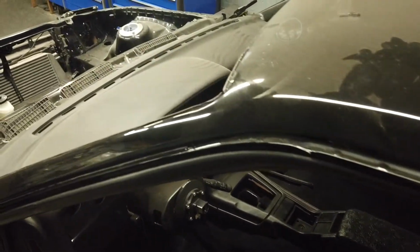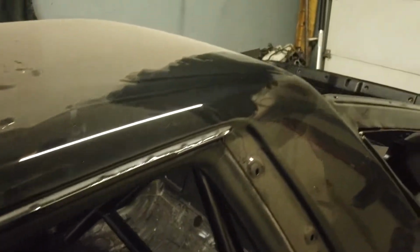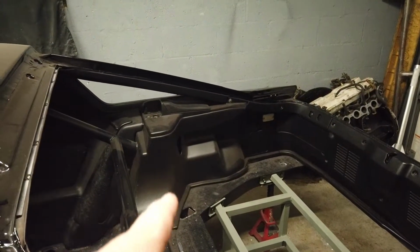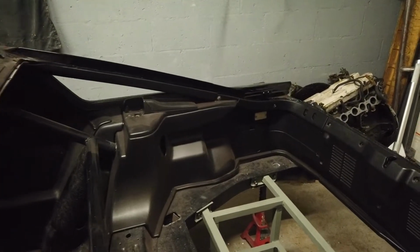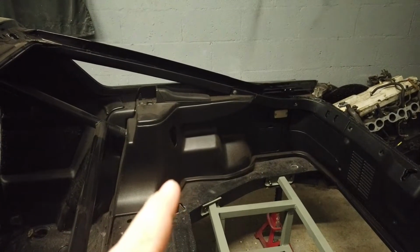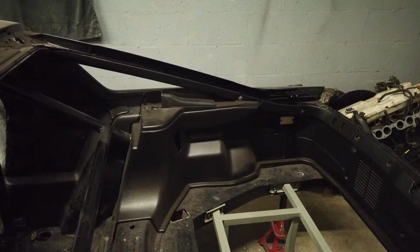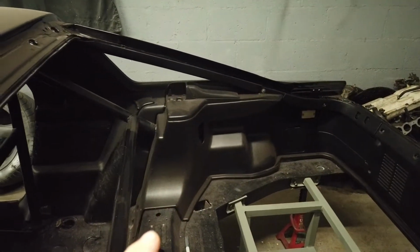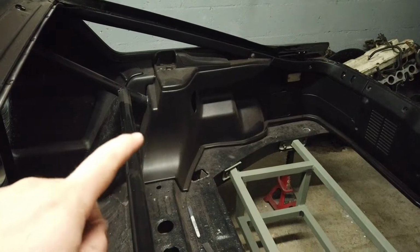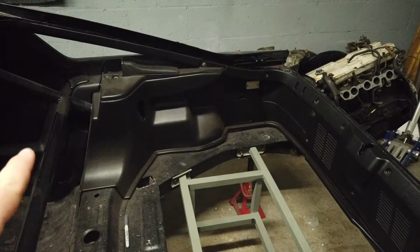All the interior panels, like the dash and all the trunk panels and everything, a lot of people end up going to AutoZone or whatever and getting Duplicolor vinyl paint, which is fine as long as you prep it right, I guess. But I chose to try to go for a more permanent solution. So this is SEM interior dye or paint, basically. And I was surprised, if you prepped all this stuff right, and you Scotch-Brite this and wash it with Dawn dish soap and everything, and actually take your time spraying it and layering it properly.